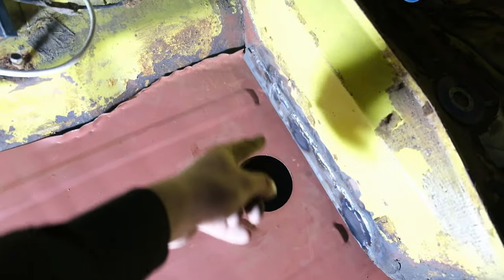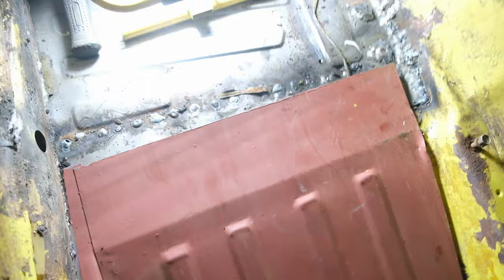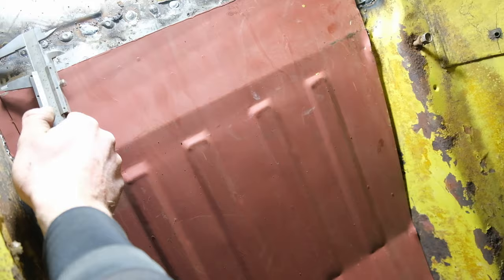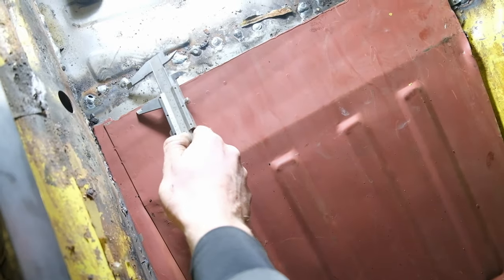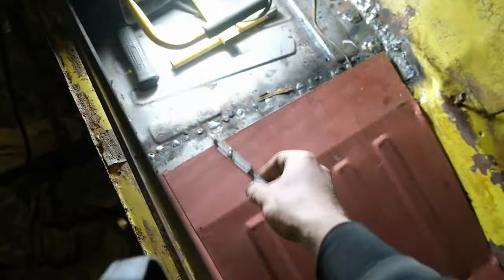While you've been gone I've finished off the seaming of the welds — you can see the penetration back there. I've also welded in a little bit of angle iron, though I haven't welded the end because I'll save that till last. I'll have to file all these edges back. With my vernier calipers I want this line to line up with that line, so I'm going to take my scribe and score down along there to neaten it up before cutting.